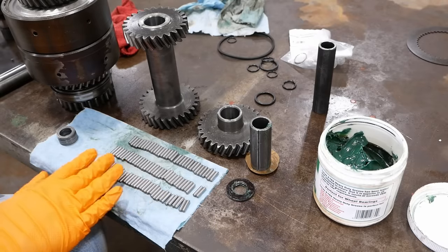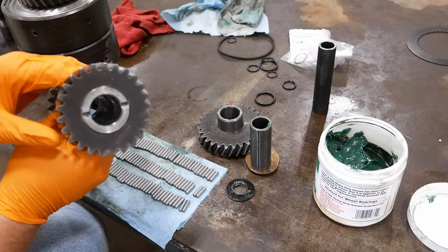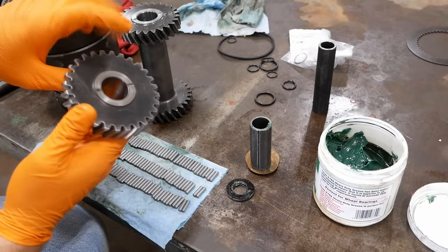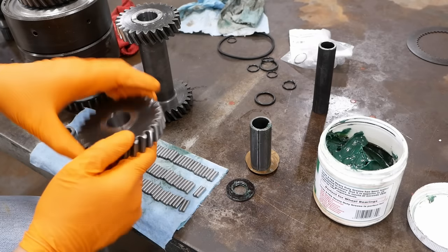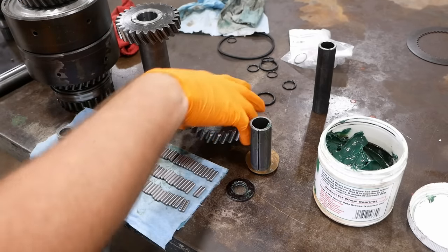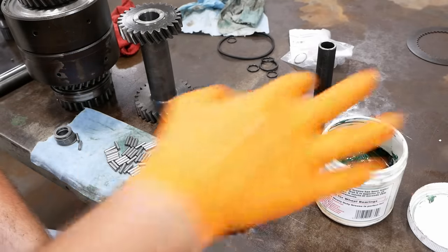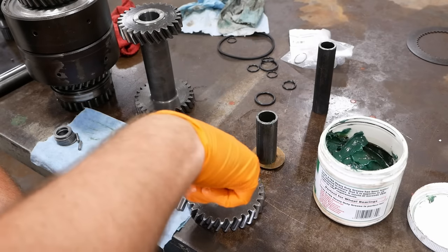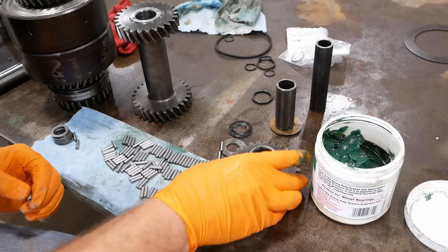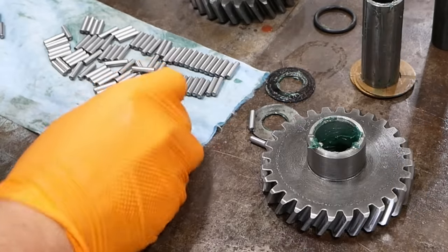I went ahead and stripped everything back down, cleaned it up, looked it over. The rollers look fine. The inside surfaces of the counter shaft and the idler look fine — there's one little tiny spot right there, but it's outside of where the rollers run, so we're not going to worry about it. Ideally we would replace everything, but this job is far from ideal. So we're going to go with it if I don't drop all the bearings all over the floor. There goes one — so we're going to pack them again. The funnest part of a tedious job is doing it the second time. Using grease to hold everything in place — it may not be necessary, but it certainly makes it a lot easier.